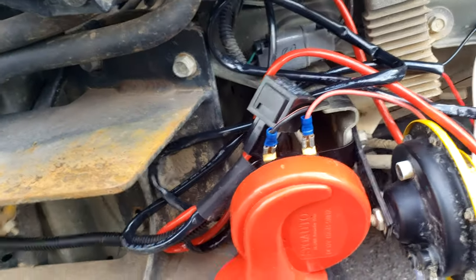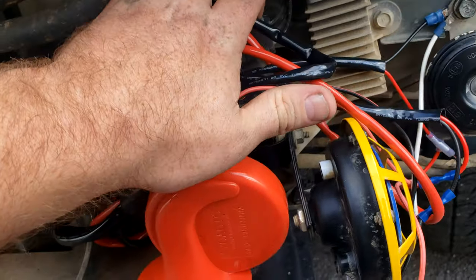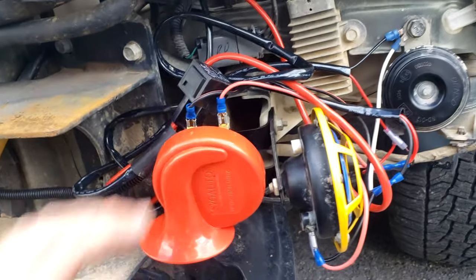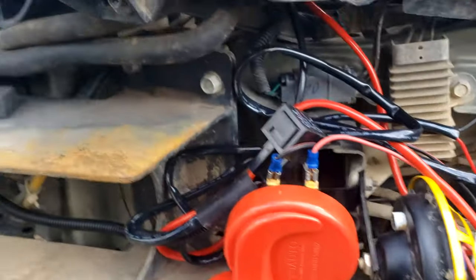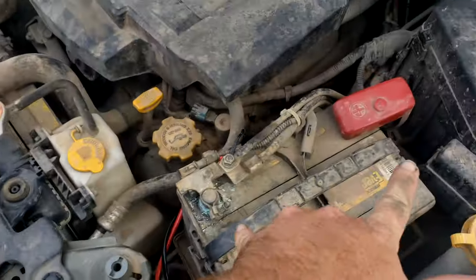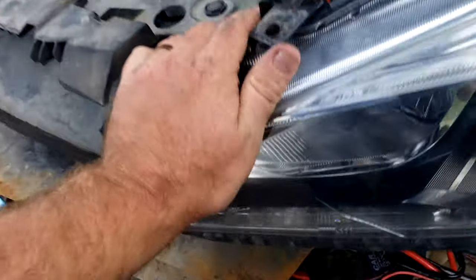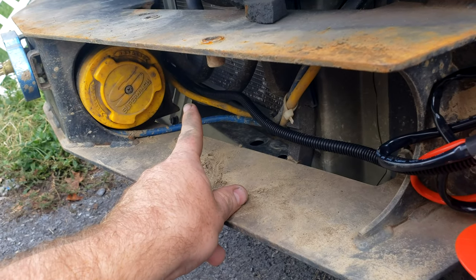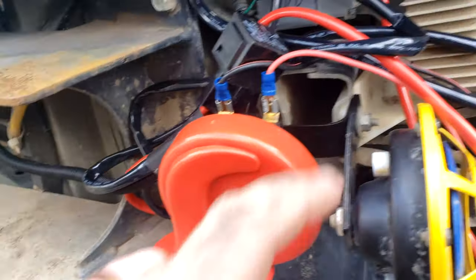As far as the wiring, it's a little not as clean on this side, but no one except for you guys is ever going to see it, so I don't really care. We've got the 40-amp relay here — that goes to the positive and negative terminals up here. Then they come back: one goes across the bumper beam over to the passenger side horns, and one stays here.